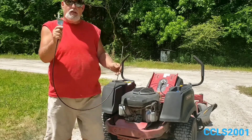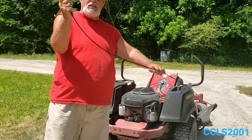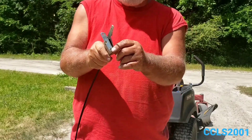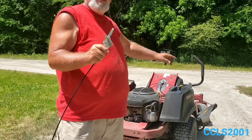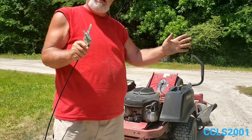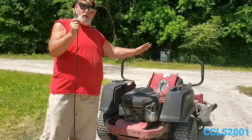The trick you need to know about this — if you have one of these or a Cub Cadet with the same cable — these holes are not threaded. You have to use the bolts that are inside your command center to thread them first. I've already pre-done that before the video, so now I'm ready to put it on.